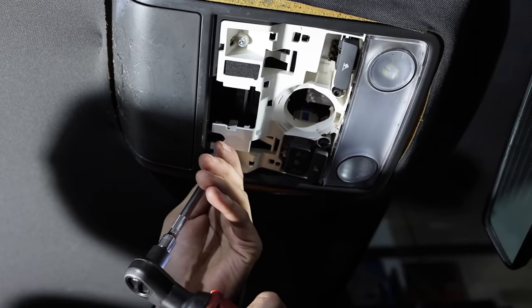Now it's time to get to the pillar, the two side pillars, and then the two pillars in the front to release the headliner. This is why we removed the battery — because as you can see, these are all labeled airbag. There's a side curtain airbag on both sides, so it's just a precaution. For the pillar removal, first remove this little airbag tab — these break extremely easy so just be careful, and if you break it it's not the end of the world. Under there there is a T20. We'll get that out of the way.